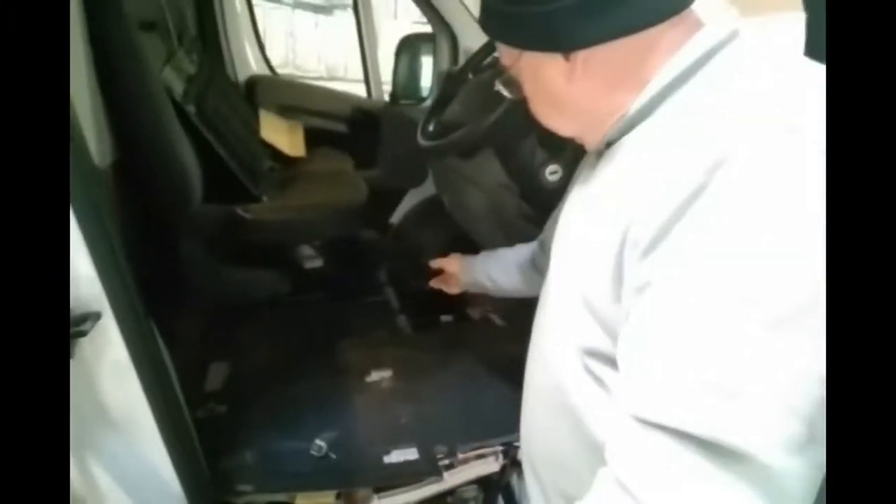I did check with the experts — the supplier — just to make sure I wasn't going to throw any of the readings out by using different cable sizes, and it's fine. I've come in today to route this cable between the solar controller and the van battery. It's going to come down the door post on the inside, out at the bottom of the door post, and underneath the mat to the batteries. I'm also going to put the two inline fuses connected to the two batteries before connecting the cable, and I'm going to put an isolator between the solar panel and the controller, just in case you want to do any work on the system in the future.